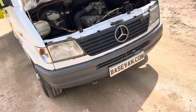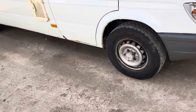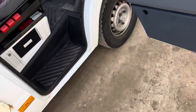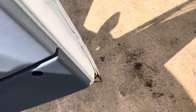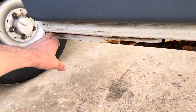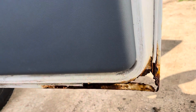In fact the only place where I can see where it needs welding is on the driver's side door, and that would probably put it down to it being a low mileage vehicle — I imagine the driver got in and out quite often and that has just resulted in that door just falling to bits. But these skins are available online so it's just a case of chopping and replacing and it's as good as new.